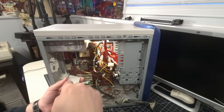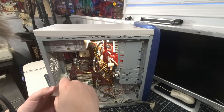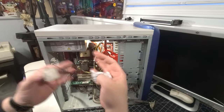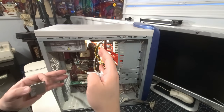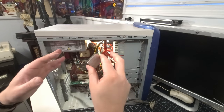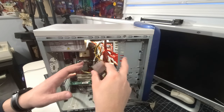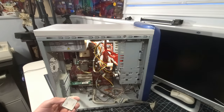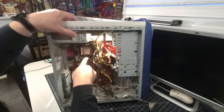The processor seems to be okay visually, but this computer needs a lot of TLC. I want to take it all apart. I feel it's salvageable — I'll take it out of the case, pop in good working memory, get the CPU properly seated, and do a test bench run to see if everything works before putting in all the work of restoring the full case.